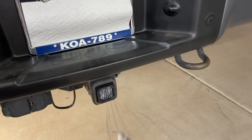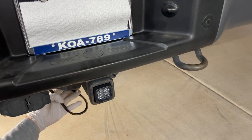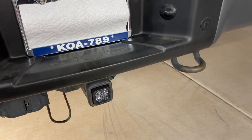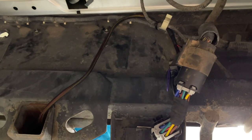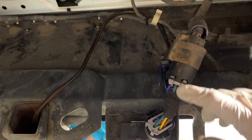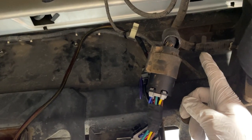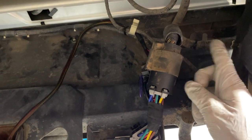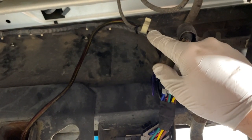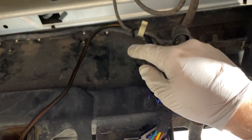That's now in place and should work just fine. I'll do a little bit of tie-wrapping underneath here just to keep the wiring out of the way of my spare tire. For reference, if you have a first-generation F-150 Raptor: the factory wiring harness folds up and I zip tied it a little further up. There's a factory tie-down there as well. The Deutsch connector harness going to the light I just looped through a clip that's seemingly unused on these trucks, then zip tied everything to the factory wiring harness.